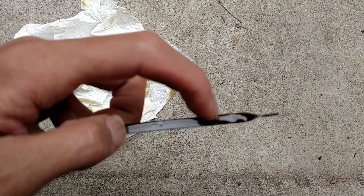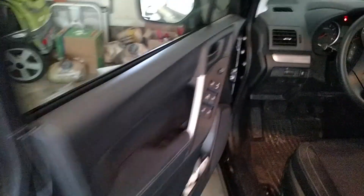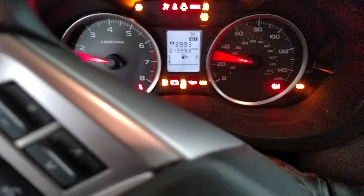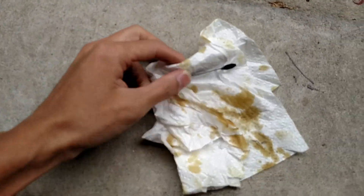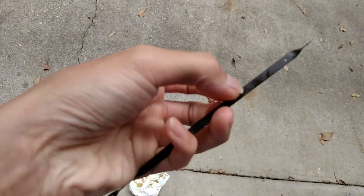So this is about 0.8 quarts — I would say 3 fourths, about 0.7 quarts low. And right now, my car — I want to show you this documentation so everybody knows exactly where it is. This is the manual. It has 13,993 miles. The last time I did it was around 12,000. So in less than 2,000 miles, I've burned almost a quart of oil. This is speeding up rapidly because the last time, at 3,000 miles, it was about 0.8. Now, not even 3,000 miles and I'm already almost one quart low.